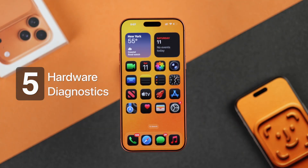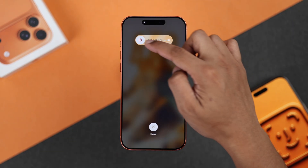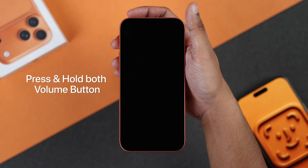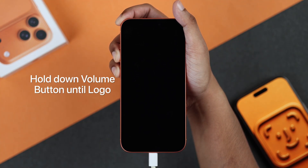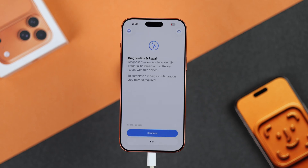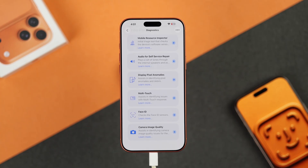If not, there may be a hardware issue with your Face ID module. First, turn off your phone and make sure you have a charger handy. Hold both volume buttons together, then plug in the charging cable while continuing to hold the volume buttons until the Apple logo appears. Let go, give it a few seconds, and this will boot straight into Diagnostics mode. Connect to your Wi-Fi, run Diagnostics, and from the list select Face ID.